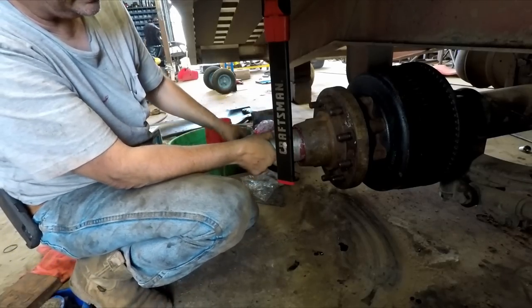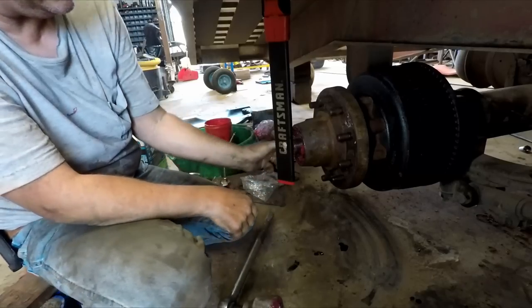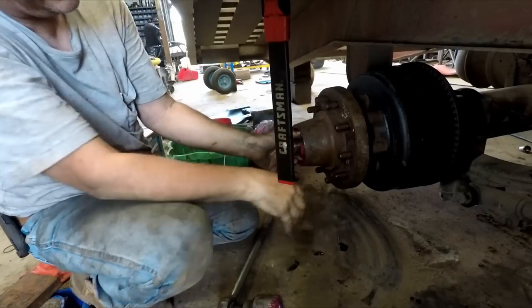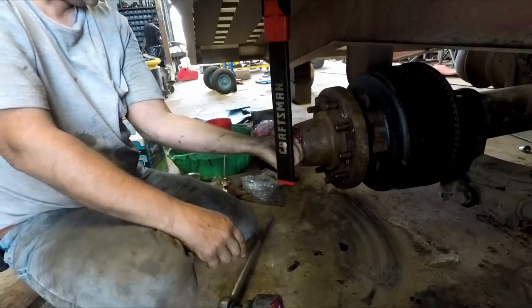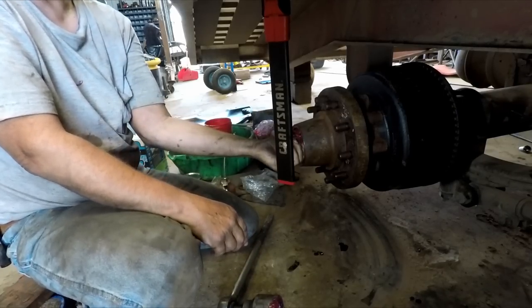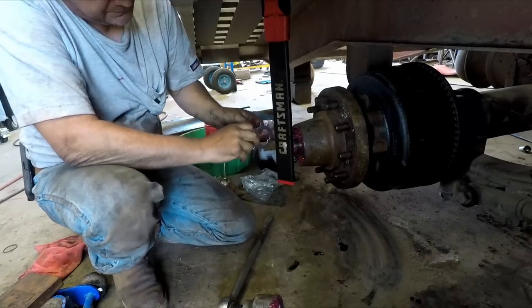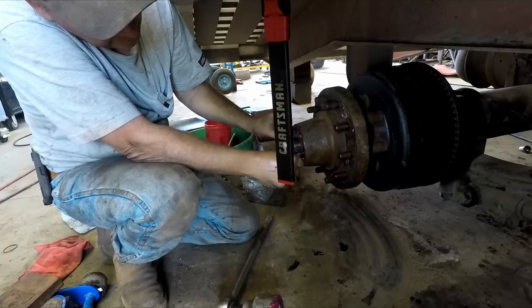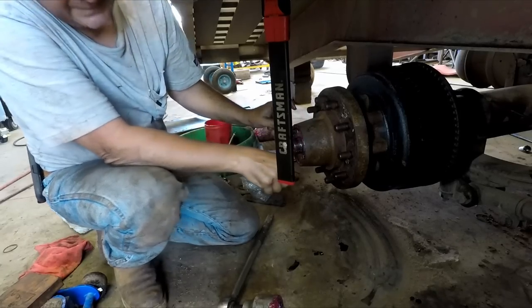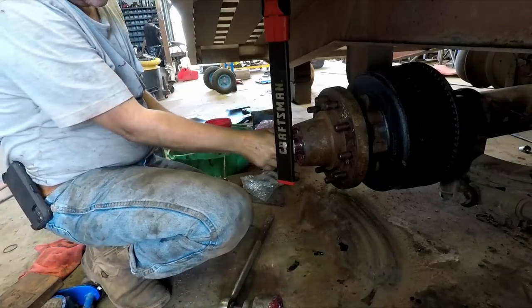Before this day is over I will be covered in grease. So what we do is go finger tight and then I go about a quarter turn. You might be able to get one reuse out of these locking washers, but if you're doing a Dexter axle I'd go ahead and buy a new one because these things don't survive more than one or two sessions.